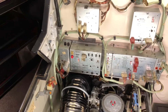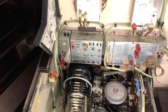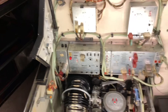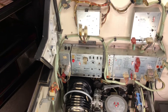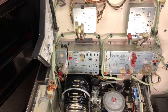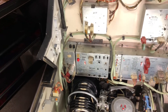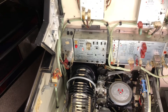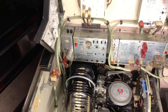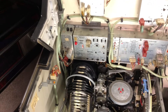It's also a nice luxury to have a good known amplifier on the shelf. I think I could make a strong case for picking up a parts box such as a 456 or 468 model — those look like dining room buffets, they're not as popular, they didn't get quite as much play since they were in more sedate locations. I'm going to pick one up this week for $150 — it's complete, it sounded good, it just stopped selecting. I'll get rid of the cabinet but it would be worth it just to have the amp on your shelf so you could substitute known good components when you have a problem.